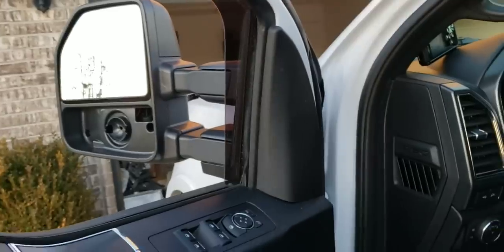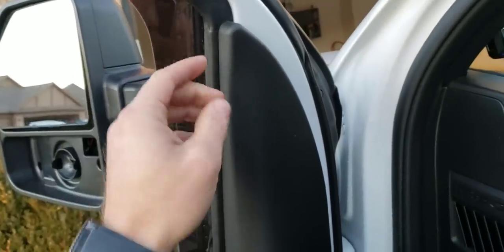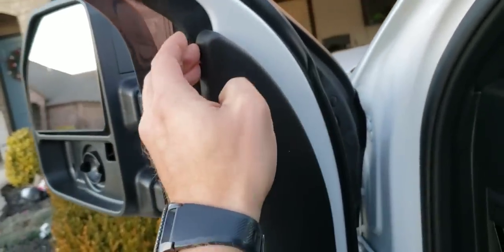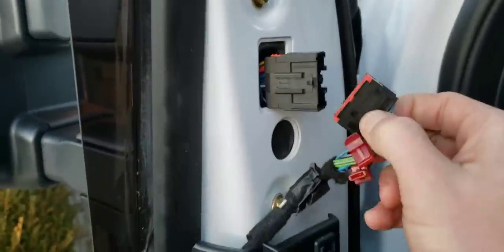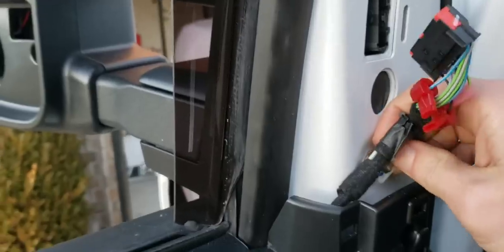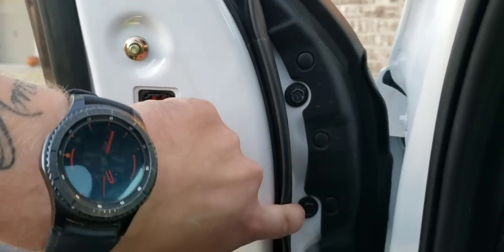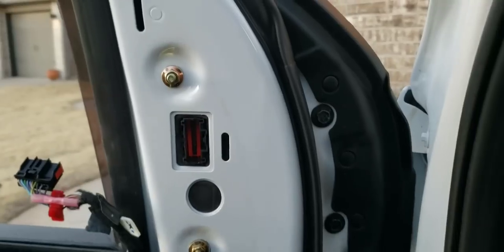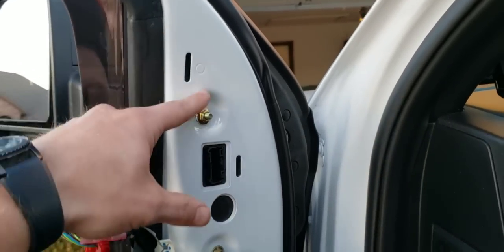I find it easier to put the windows down so you can reach through and catch the mirror. There's a plastic trim piece — on the rubber side you could probably use a screwdriver, but you can just get it with your fingers as well. There you have your wiring harness — unplug it. There are the bolts: you have to remove these two nuts and two bolts out of the mirror itself. They should be a size 10 — yep, size 10. I have to put the phone down to remove them since I need to be able to catch the mirror just in case.